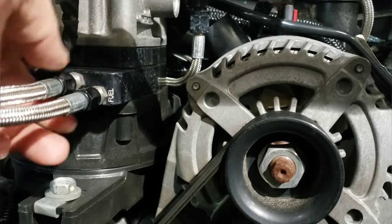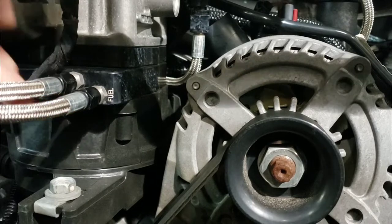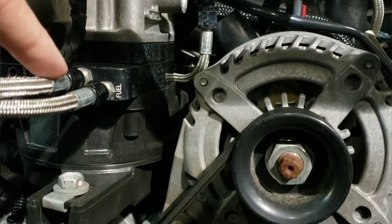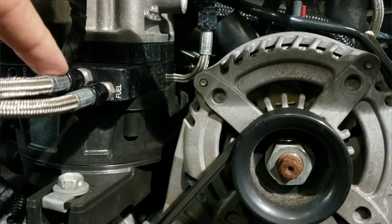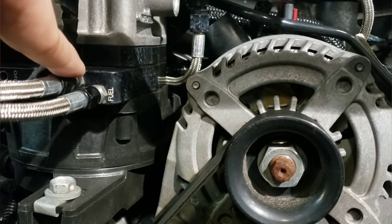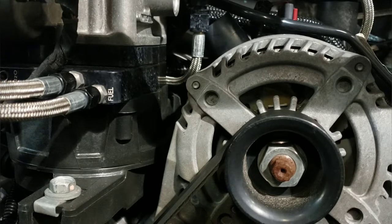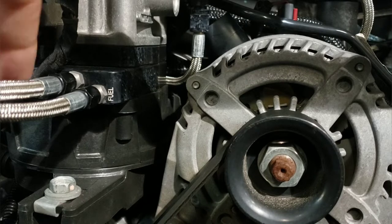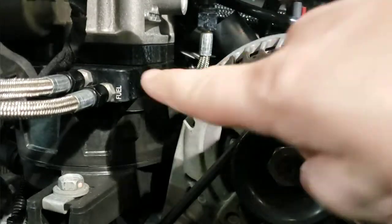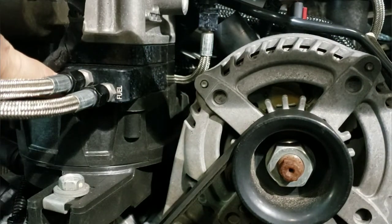If you're new with nitrous, you can never go wrong by double-checking - making sure you've got the fuel jet on the fuel side and the nitrous jet on the nitrous side. You can put them backwards, and basically what's going to happen is it's not going to mix and atomize right. How nitrous systems usually work is they atomize the fuel with the pressure of the nitrous side. The fuel comes in through the plate or nozzle, and then the nitrous actually sprays through the fuel and basically turns it into like a mist or a fog so that it mixes right. If you put them backwards, it's not going to mix right and you're going to get a big pulling effect, possibly a nitrous backfire or something like that. Just make sure on your nozzle or plate the fuel jet is on the fuel side - and on the other side it says N2O for the nitrous side.